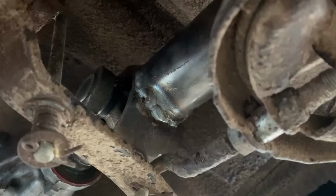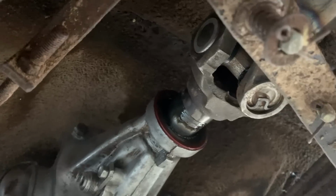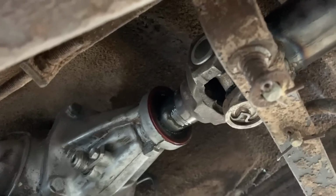Loving it. Let me get under here. Hold on. The drive shaft is in for the final time. That's the mount for the carrier bearing, and it comes up. Dad welded the yoke on. You can see it there. It fits into the transmission and doesn't shove into the tail shaft. When you bounce up and down, that yoke goes in and out. It's meant to do that. And it's spaced right. It doesn't slam into the transmission, and it's good all the way to the back.